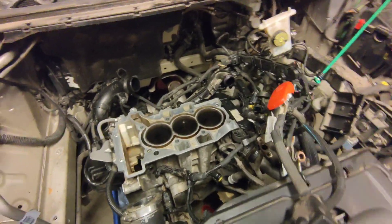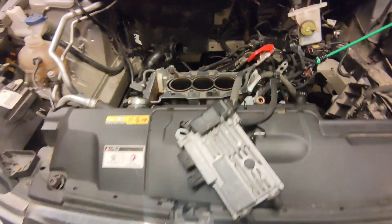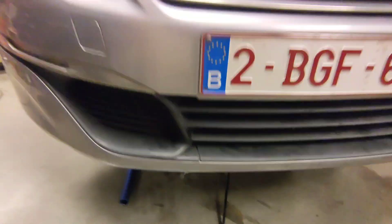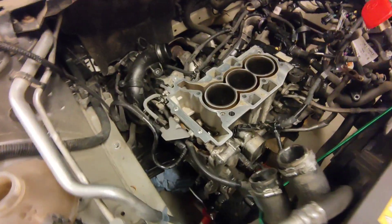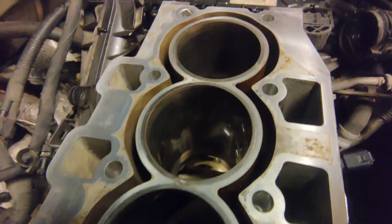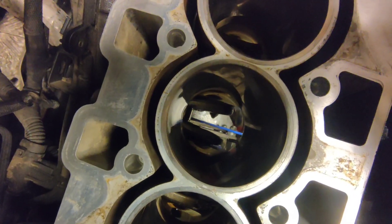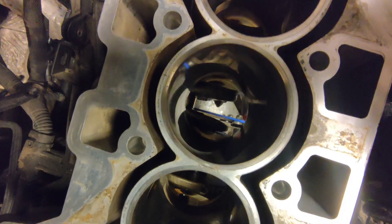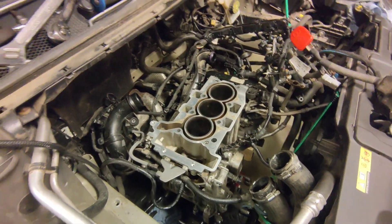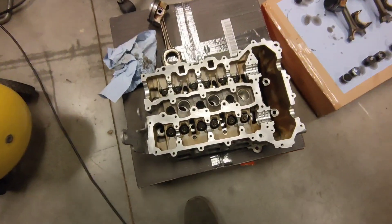As you can tell from the video of the cylinder head, we got everything out. The engine is supported on a couple of axle stands, a jack, and some blocks of wood - it's pretty sturdy. Inside, the cylinder doesn't look too bad. I'm going to remove the oil squirters, which you can see on the right-hand side on the bottom, and then we're going to hone the cylinders.